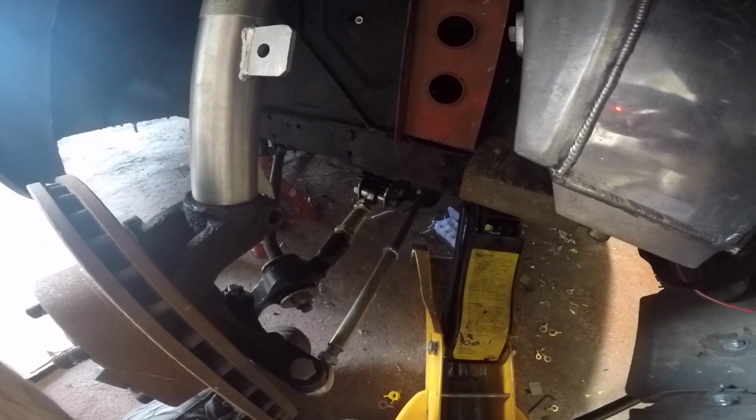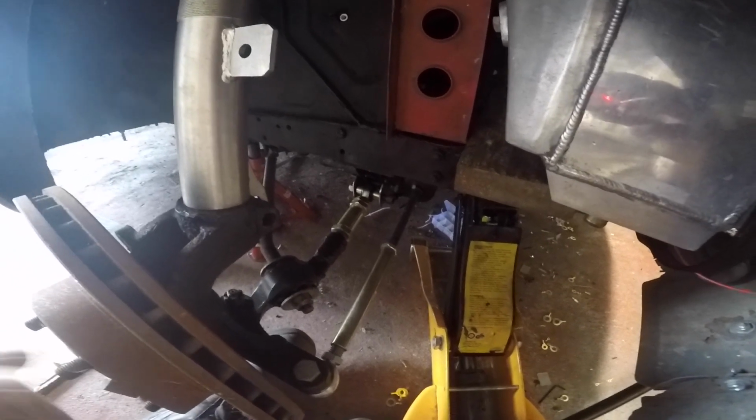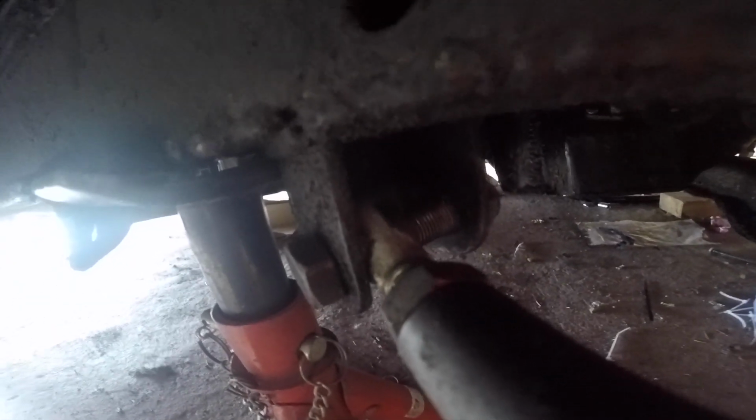Okay, that's the front wheel off and car up in the air. Just a couple of bits I need to do under here. Primarily it is sorting out the rose joints. So this one needs a boot on it. This one needs a boot, and also the brackets painting. And that one in there needs a boot and spacers. So start stripping that all down.